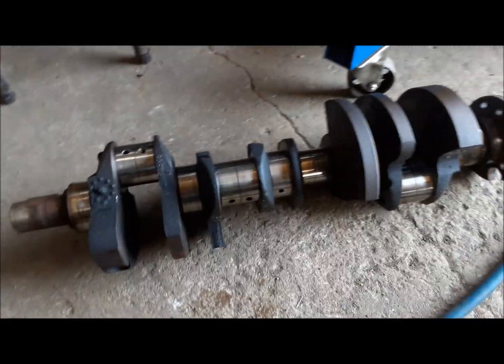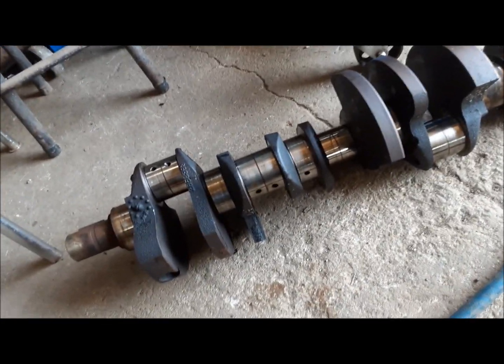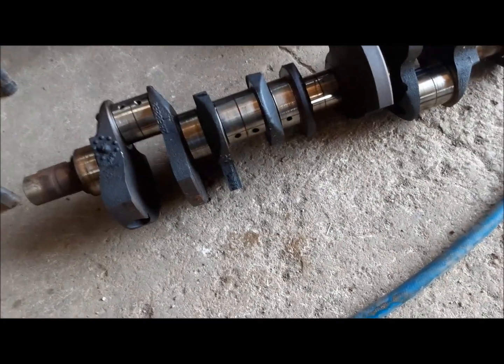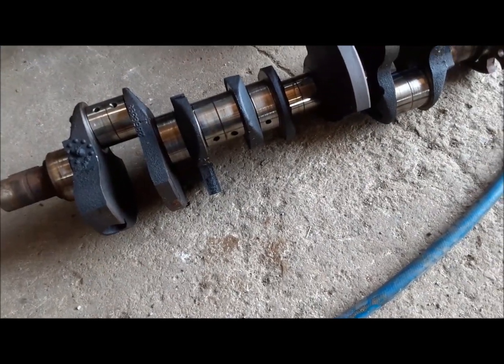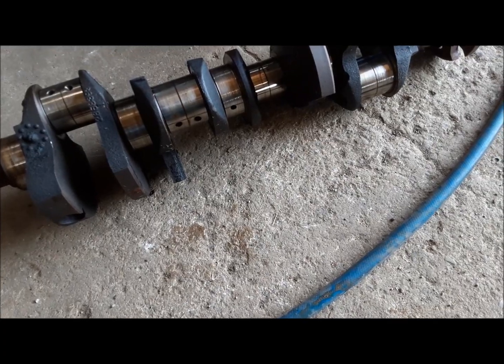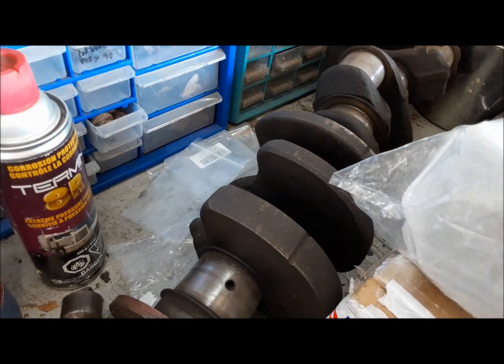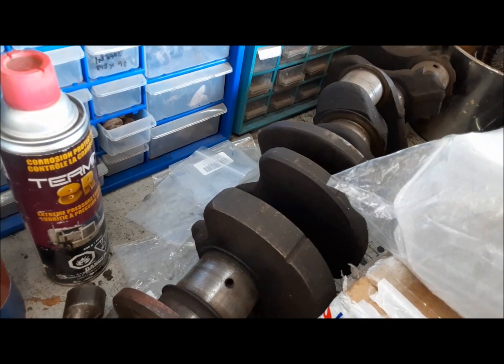And we got a nice clean crankshaft out of it. Unfortunately, it's a cast crank. This engine is a 69. I think 68 was the last year for the forged crank in small blocks, except in 340s, of course. I'm talking 273, 318. This one up here, you can see, that is a forged crank from a 68 318.